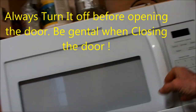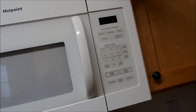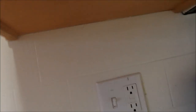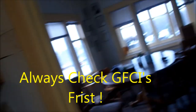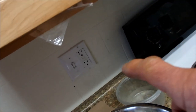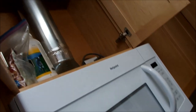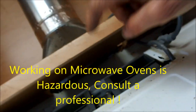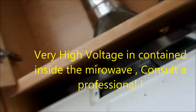For instance, the door switch — if that door switch is failing, the fuse would blow once again. I see we have a GFI socket here; some of these are illuminated but this one doesn't seem to be. Here's another GFI here — some of them normally have a light on them. I've already tripped this one; it will come on with a red light when I trip it. Supposedly they've already had someone check to make sure there's power there, but that's the first thing I'm going to do. We had power here. This was a bear to get off because it looks like they installed it after they put the microwave in. I'm going to have to take the side off to check the fuse.